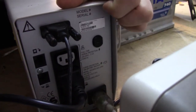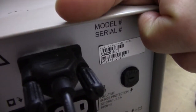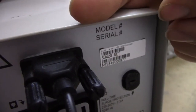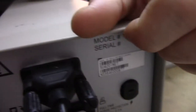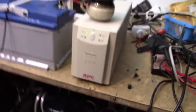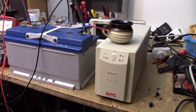There's no USB of course since this thing is from 1998. You can tell the date of any unit by looking at the serial number — this one ends in 9846, meaning the 46th week of 1998. That holds true even for the black units and I've seen it on some newer ones. Also you probably shouldn't use this LAN protector on anything more than a 10 megabit line — I doubt it's particularly well shielded internally.